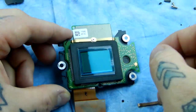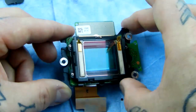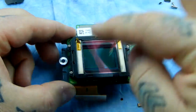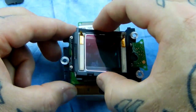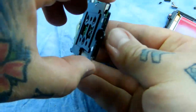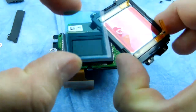But if dust gets into the side, because it's an electrostatic attractor, and if you go to raise your shutter on your camera and you're cleaning it, you're not cleaning the sensor. All you're doing is cleaning this filter way above the sensor. You'd actually have to take the whole camera apart. That's the reason why there's that rubber gasket — to keep dust out. And we'll remove this dual layer right here, so we have these two pieces over top of the sensor.